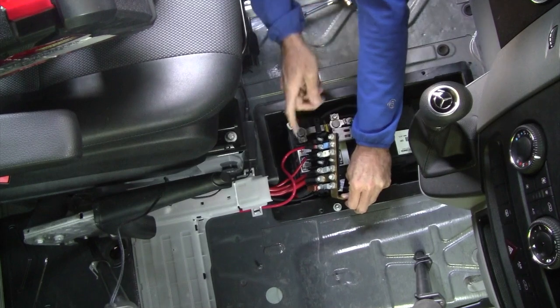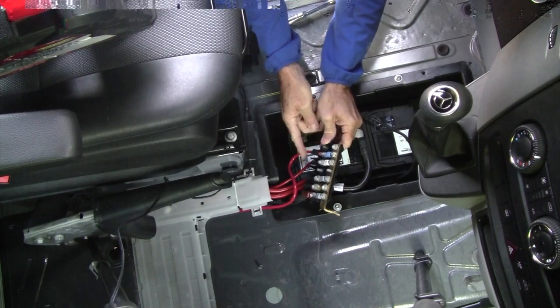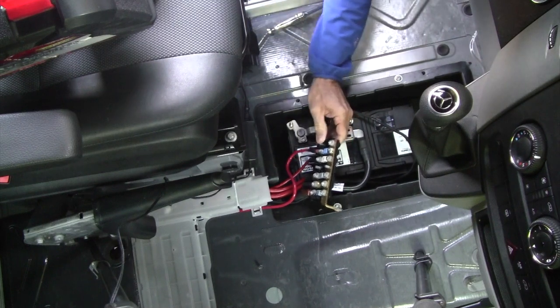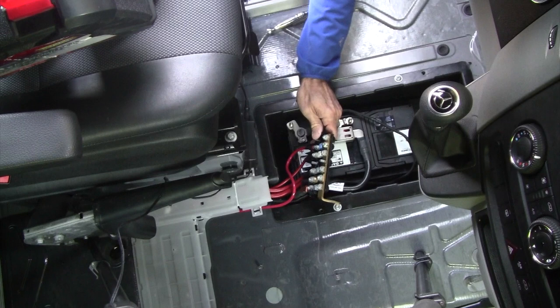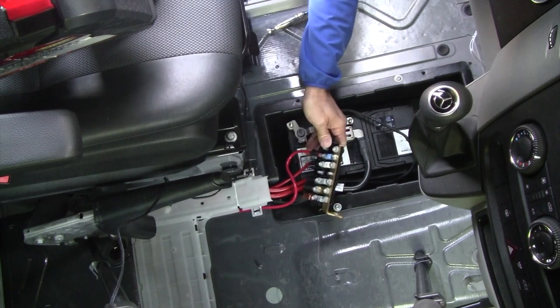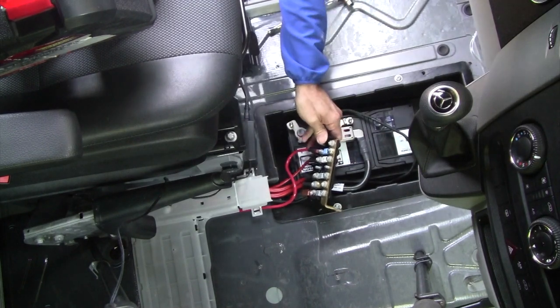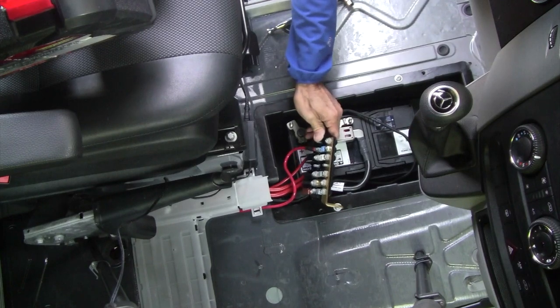We're all set. Just be aware, if you're going to do a cable run of a longer length, more than a couple feet, make sure you check the wire gauge amperage charts. In my case, 100 amp over a couple feet was okay for 6-gauge wire. If you need to go further for any reason, you're probably going to need thicker wire.